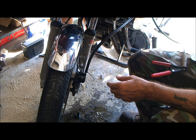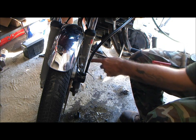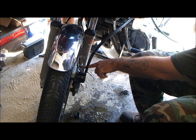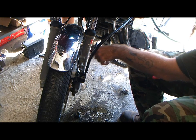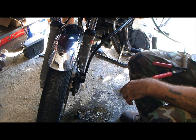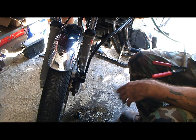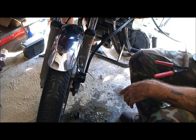I do notice too, you need a new retainer bolt on the front edge of this. Not the ones on the caliper itself, but the ones on your arm. You don't need a new spring, but you need a new retainer bolt, because whoever replaced that over the years, that's supposed to have a hole, cotter pin in it. You show me that, and I'll write that on the list, and I'll order it if I can. You're not going to get that from South County Honda, you're going to be on cb750parts.com. For pads and stuff, South County Honda, they're great. But for little bolts like that, cb750parts.com, you'll probably pay more for shipping than you will a bolt.